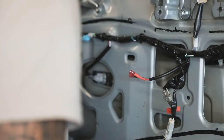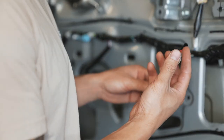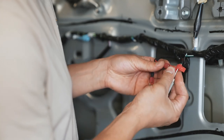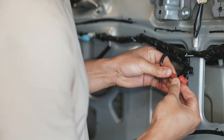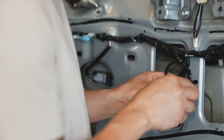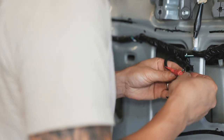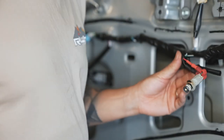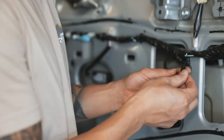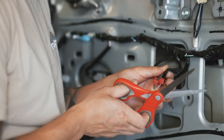This here is the T-tap piece. With the T-tap, we're going to need to clip it to whatever wires you guys are clipping it to. I'm going to trim the sleeve back a little bit so we can have a little bit more working space. So for the license plate, there's going to be a green wire and a white wire with a black stripe. It doesn't matter which one you install the T-tap onto first, but it will matter when you guys are connecting it to the actual T-tap connectors. So we'll put the T-tap over where the metal is, close it, and then using a pair of pliers, squeeze it shut and you guys will hear it click — that means it's locked in and we've made connection with the wire on the inside. We're going to do the same to the other wire. Now we got both T-taps on.